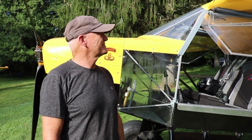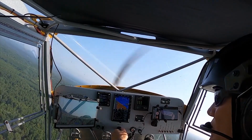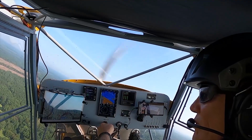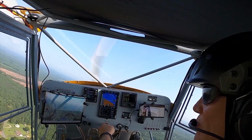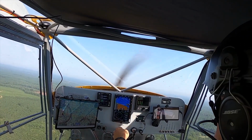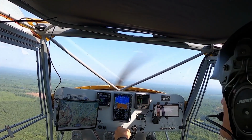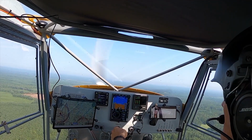Right. It's about 665 pounds, that's dry. 665. Wow. And you've got useful up to 1320, LSA, right? Yeah. So besides 2 people in and full tanks, 26 gallons, I can throw a couple of 100 pounds in the back if I need to for gear.